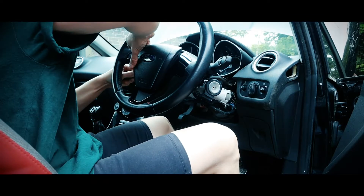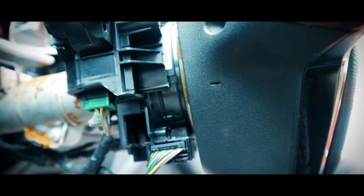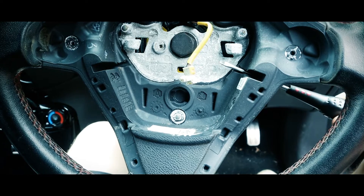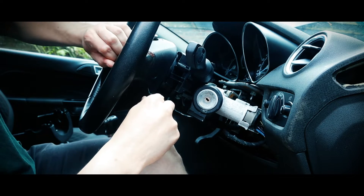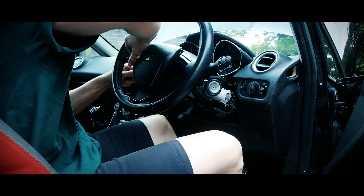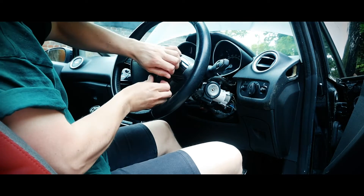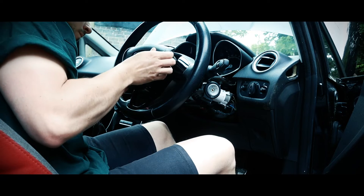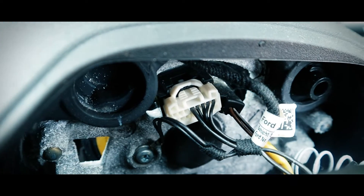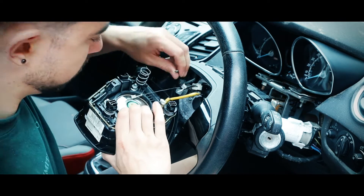I am hopeful I'm going to be able to do it on this car once I've fitted those controls along with that new trim. Before I can remove the trim I need to pop out the airbag — it's released by two spring clips inside. The only way to access these clips is through the little slots in the side of the steering wheel using a long thin screwdriver. As you release them you want to pull forward from the top two corners of the airbag, but just be careful because you don't want to pull too hard and damage any of the wiring inside. Once both corners are released, a nice rocking motion from left to right helps get the airbag out.